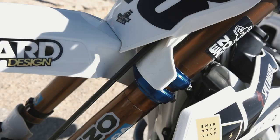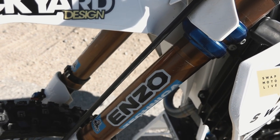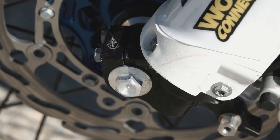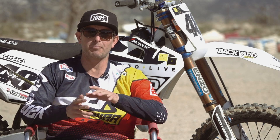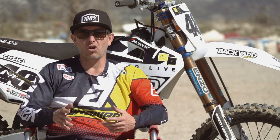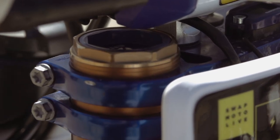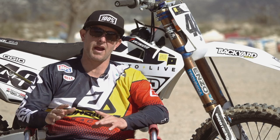So we reached out to Enzo. He did a complete new KYB bottom leg, DLC coated. The top tube is WP with a Kashima coat, and the lower fork lug is a Technical Touch fork lug. Our main problem with that fork was how busy the front wheel was and how inconsistent the position was coming into turns. Don also doesn't like checking the air, so they gutted the fork, put KYB internals in, and we used the existing Husqvarna axle. We had Enzo also do the stock WP shock to match.